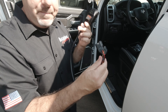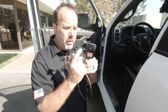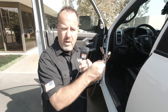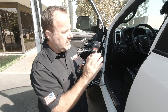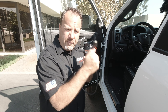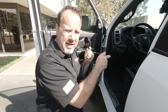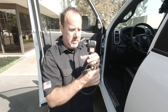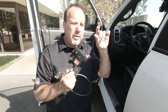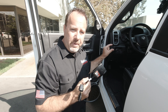But here's where it's different. Let's say you had a Pedal Commander — this is all you would get. You would power this module by tapping into the pedal plug, which is above your big toe — the throttle plug. Let's say this is powered by five volts — it would pull that five volts from the pedal circuit. The problem is your Ram truck, your FCA, your ECU — FCA products like the Challenger, the Charger, etc. — they only have a 35 milliamp overhead on that pedal plug.